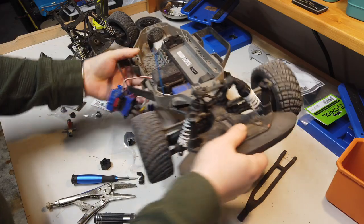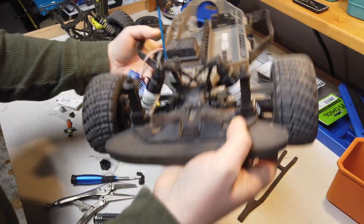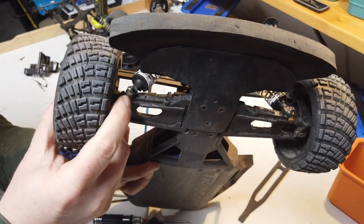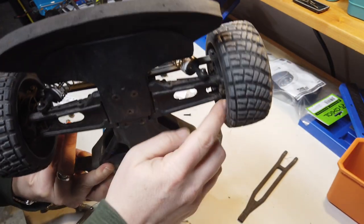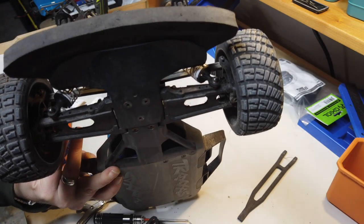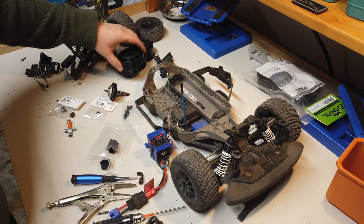The front suspension is still the stock suspension, but I've added a dual spring setup in here now. And we're running really low, and I'm all the way to the outside with that suspension link there. And that's lifted these arms up for a lower front end. Also gonna have a little bit of fun here.